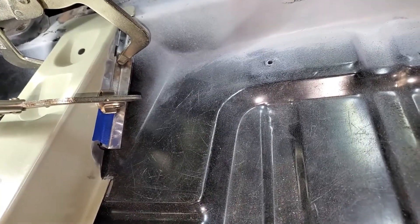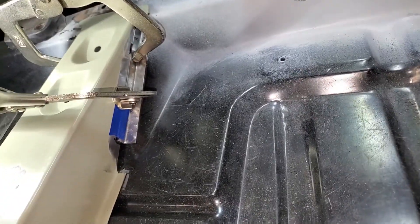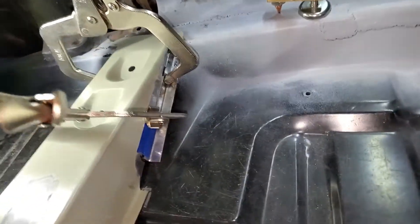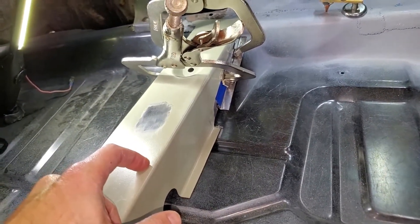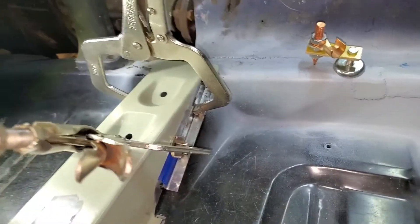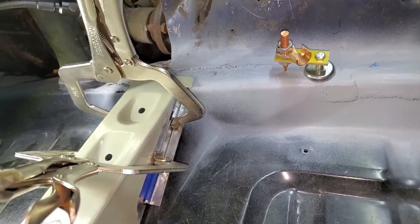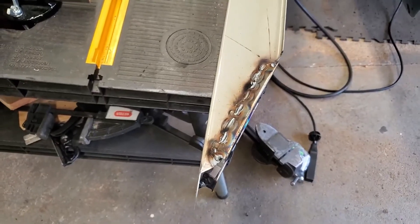It's also marked with sharpie so I know approximately where the alignment is for each side. I had to cut the flange from all the way over here up to the corner — it just wasn't fitting correctly. I don't know if the cross member was stamped wrong, or the floor was stamped wrong, or the supports inside were put in the wrong place, but it definitely was not fitting nicely. When it doesn't fit nicely, you've got to make it fit nicely — that's the plan.